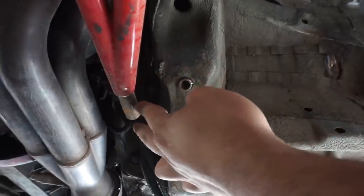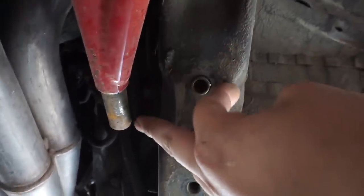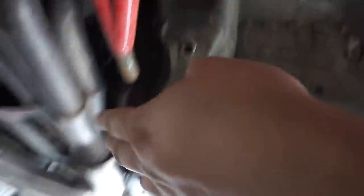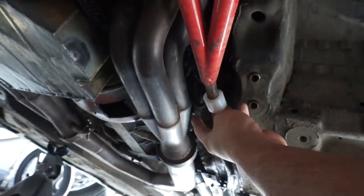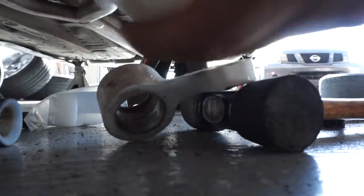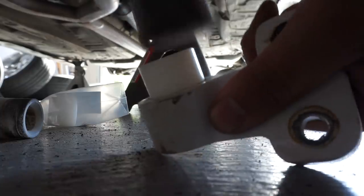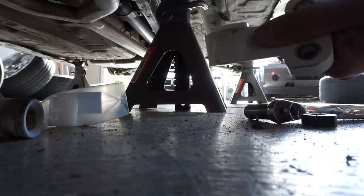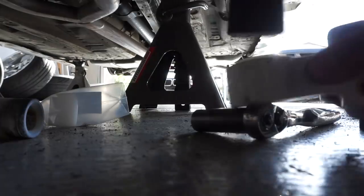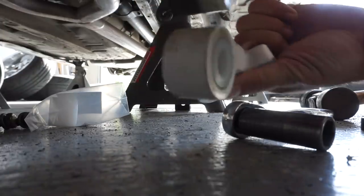The Condor design was made to work with the E36 arm. SLR has a longer section of piping here that the bushing can slide onto, so Condor didn't make it for the SLR kit — they made this bushing to house the E36 M3 arms. What we're going to do is figure out how to get this thing to stay on with the horseshoe clamps. I'm going to press this in by tapping it with a hammer. Use a soft rubber hammer so you're not destroying or oblong-ing the bushing, and it should get pretty much flush.